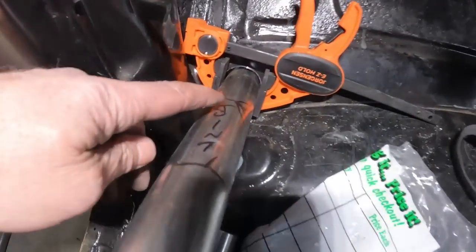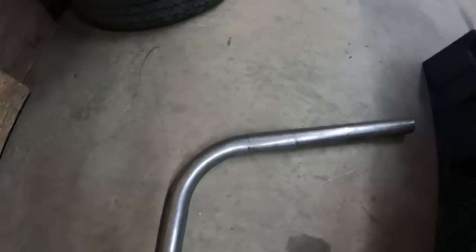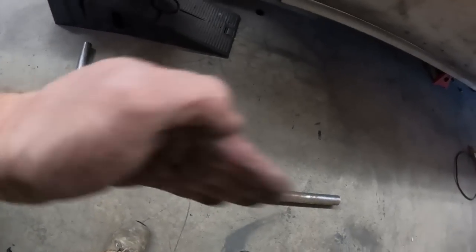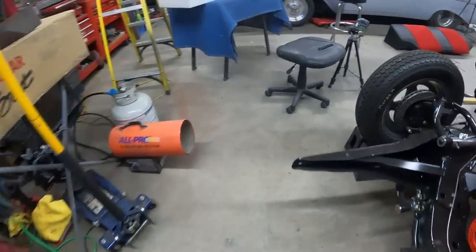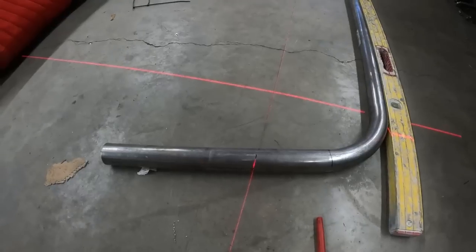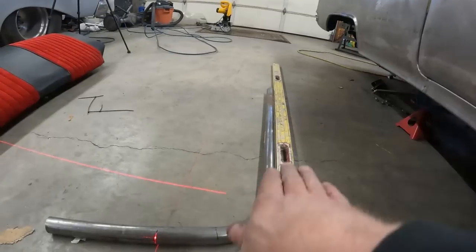After a little more measuring and marking, I've put a mark on the bottom here — that's where the joint's going to be. I need to come through the floor three and a half inches. This piece I've got to figure out how to make work because it's not a 90-degree bend. So that's going to come off the frame and up through the floor three and a half inches. I've got to make sure it's in the same plane as the door bar. I measured from the frame to the outside of the door bar — that's ten and a half inches.